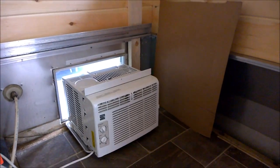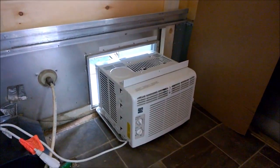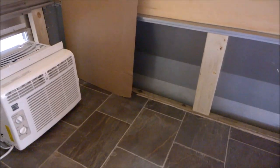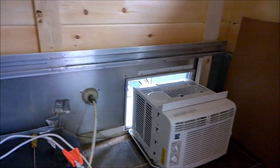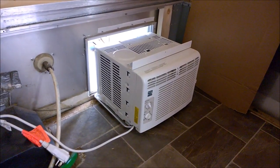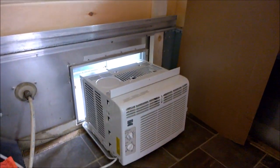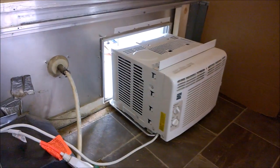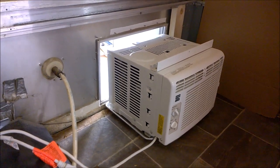So I think this is what we're going to do. What this will mean for the floor plan is I'm going to change it a little bit. This was going to be an enclosed area for a porta potty, but since this is such a small space used by one or two people, I think we can deal with a pull-out porta potty out of a cabinet or storage area inside. For the air conditioner, I put that access panel in when this was a pop-up, but unfortunately it's a little too small — the opening is about 11 inches and we need about 12 for the air conditioner, so that's just not going to work.